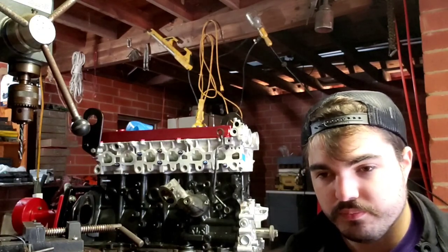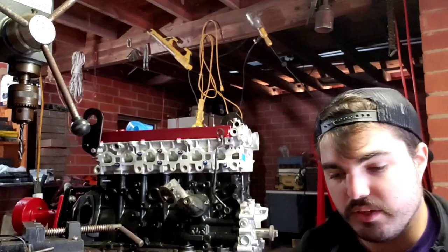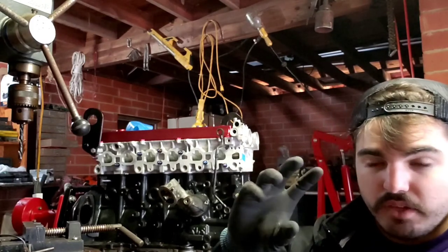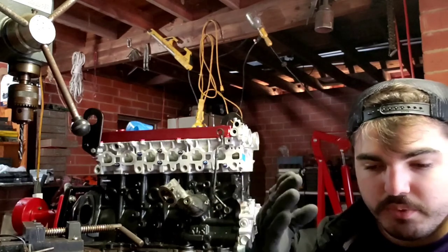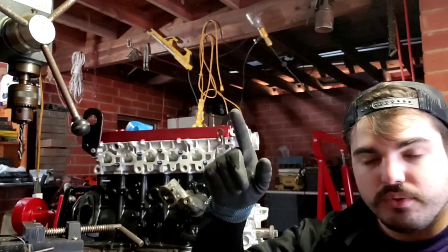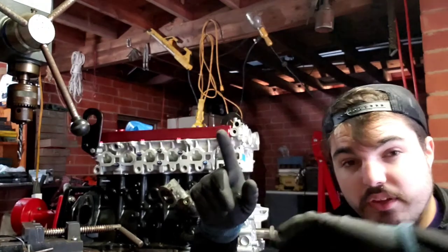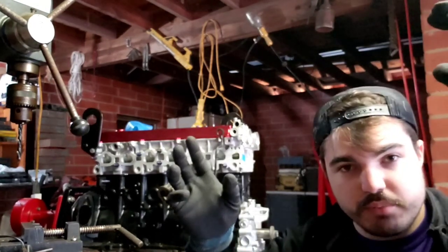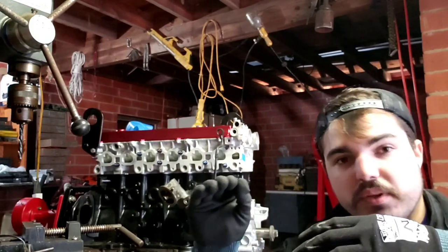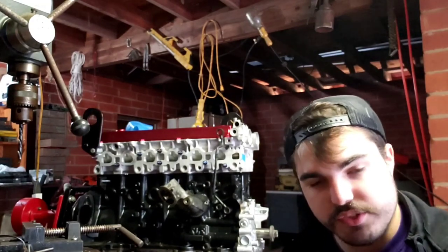So then I can control boost pressure and turbo RPM independently, because normally they're dependent on each other. That could allow for really fast and really accurate launch control, because I can control the turbo RPM and boost pressure differently. So I can have a really high turbo RPM for launch control, but have the electronic throttle body fully open, bleeding off all the boost pressure, or whatever boost pressure I want to leave at. And then when that closes, I'll be leaving at that turbo RPM and have a really solid launch out of that. The same thing applies for a rolling launch control as well.